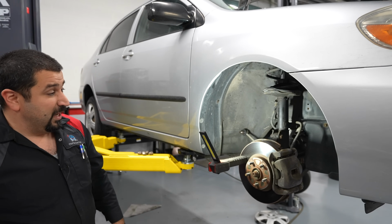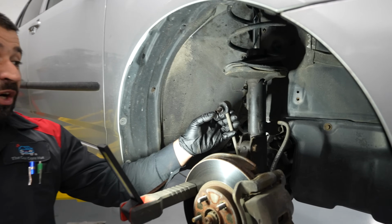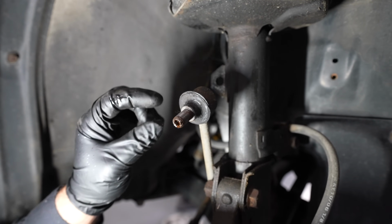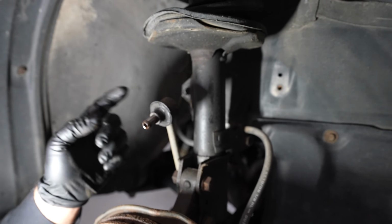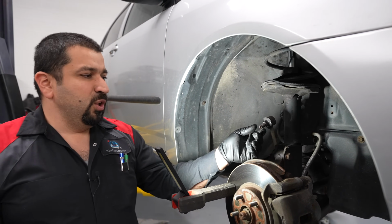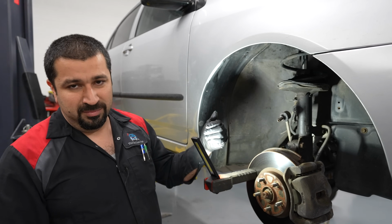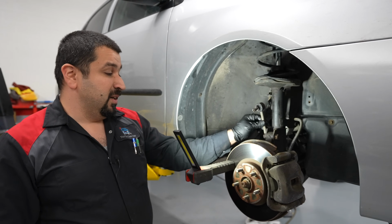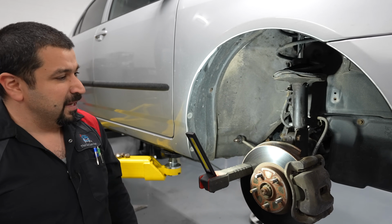Especially if you have a Camry where this stud is long, you're gonna have a large exposed part. So I'll share with you a few tricks if this is stuck and basically the whole thing starts spinning. You can use heat. Heat destroys the rubber boot, and now this could potentially destroy the sway bar link. You could also find a second nut, run it on the stud to clean the thread before you remove it. That helps a lot. Patience is important here. Otherwise, just get new sway bar links and cut them and be done, because sometimes they'll never come out.